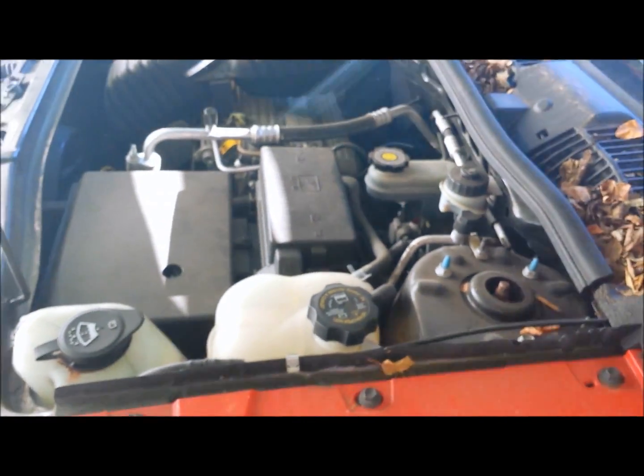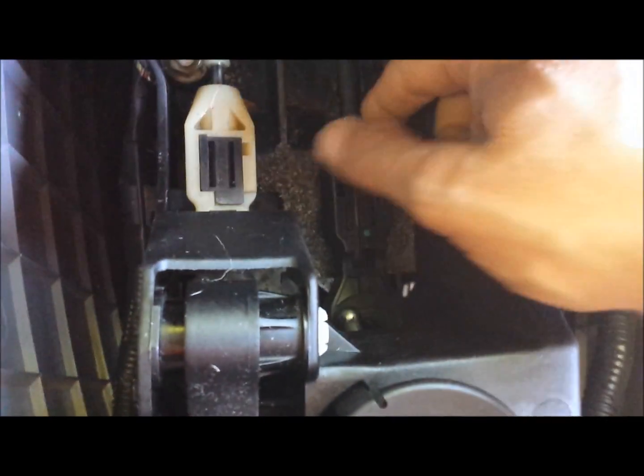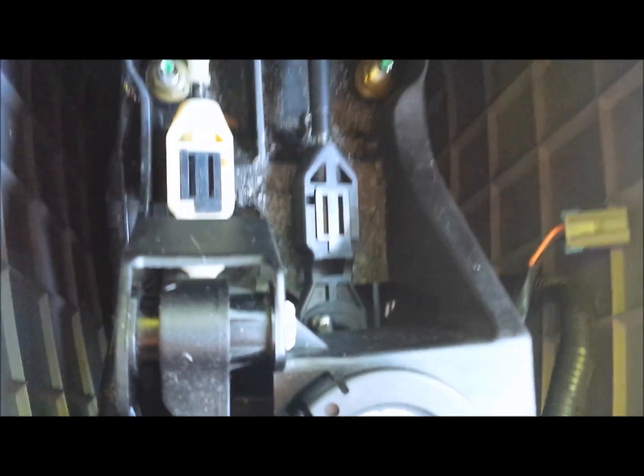I am on the driver's side, coming in at the master cylinder here. If you look down in here, you can see the two cables — there's a black one and a white one right there. To move it, reach down in here. What we're after is this black one — it's just the same color as the one that's in the console. Pull that towards you, and I think you basically put the car in fourth gear. It moves back and forth fairly easy. And if we go back inside, now you can see that it's been pulled forward — it'll be much easier to get to, much easier to replace.